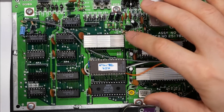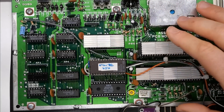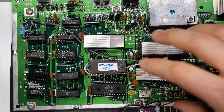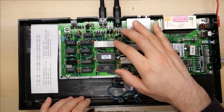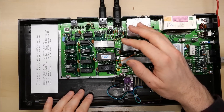Underneath these three heat sinks is also where the PLA chip resides. This motherboard design is for the Commodore 16 — of course it's a different layout in the other machines of the same architectural design, but they all use the same PLA chip. And just like in the Commodore 64, if this chip dies, you just get nothing when you turn on the computer — black screen, basically.